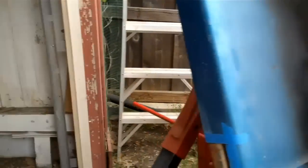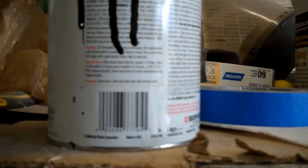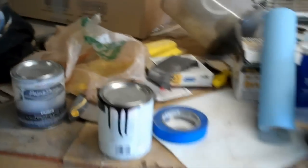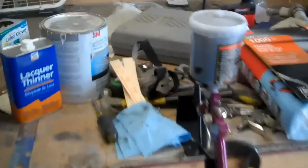I put another coat of paint on there. There's the problem with working outside on a windy day — you get all kinds of little crap that blows onto your sticky paint. It's still tacky — it's probably been half an hour since I sprayed. While it was drying, I went to the store and got some thousand grit sandpaper and some paper towels. I was looking at the can for re-coat times. It says may re-coat when fully dry, usually in 24 hours. Dries to touch in 2 to 4 hours, and to handle in 5 to 9 hours. Yeah, it doesn't dry very quickly. Maybe if it was reduced even more, it might dry a little quicker — I'm going to experiment with that.